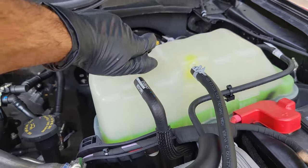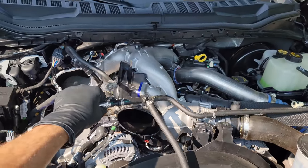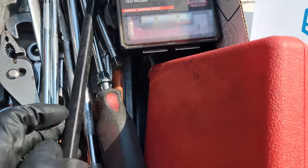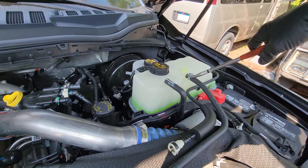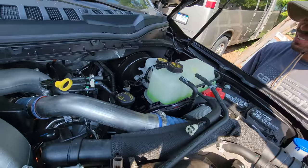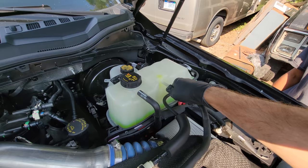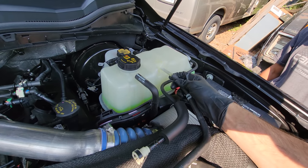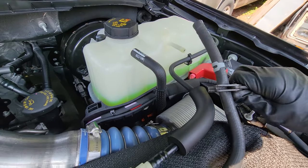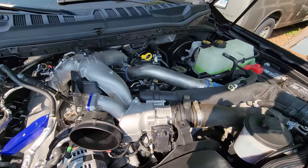One of the things I'm going to do is let all the pressure out of the cooling system — I'm not going to drain it. I've already removed the cap and relieved the pressure. Since I have this line set sitting here, if I just get this section off I'm going to be able to peel this all the way up and out of my way. Let me get my pliers and we're going to gingerly work this clamp off. We're just going to pull this line off — twist and pull, people. I don't think that much coolant should come out since we're not running. We got it clamped off and she's not leaking anymore. I'm just going to get this hose up out of the way so it's a little more accessible.